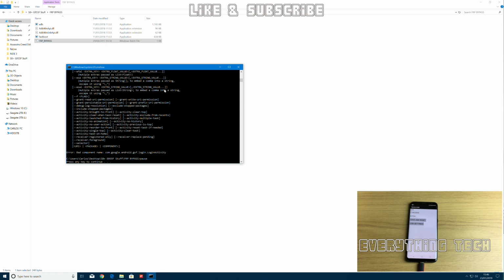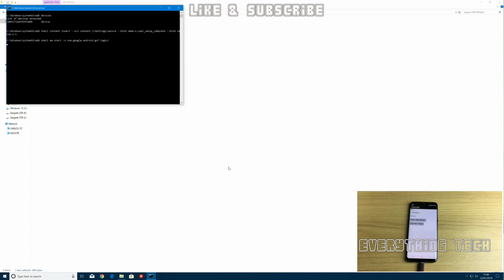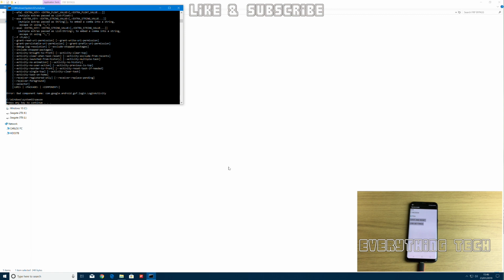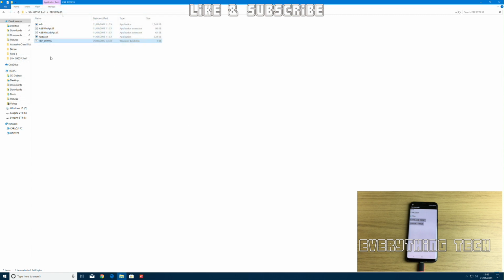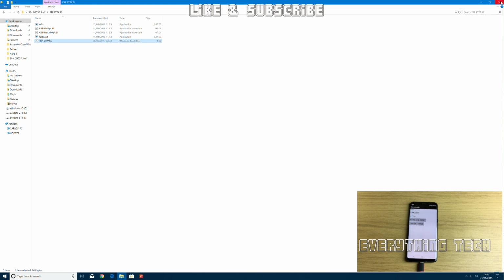And I normally do this a few times just to make sure that it's going to do it, because if you just do it one time and reinstall the full firmware, then you need to go back again and get to the factory binary and install the factory binary. It's just wasted time. Just make sure that it's gone through. Either double click or right click and open as administrator.